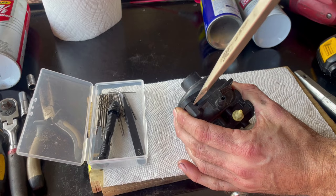Now to reassemble — with the fuel inlet pointed to the left, we put the cartridge back in with this part facing us and press it back down. We'll get the needle valve back in and press down on it. Now it's almost ready to go back together — but notice how this is really stiff, so we'll pull that back out and make sure we get it cleaned up so it moves nice and smoothly.